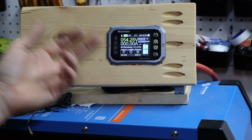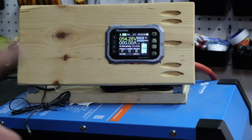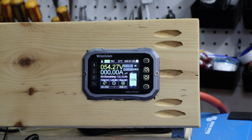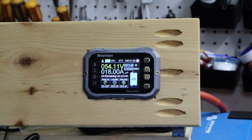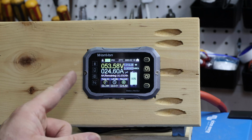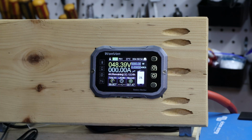And up here we do have our meter, so you see, even though it's a mess, we are actually measuring. So that means I'll get started. Let me turn this thing on. Oh yeah, a little bit short, 20. So let's see if I can bring some other sources as well. We just ran out of juice, a little bit below 100 amp hour. Very short, sadly, but it's advertised with 100, so it failed the capacity test, sadly.